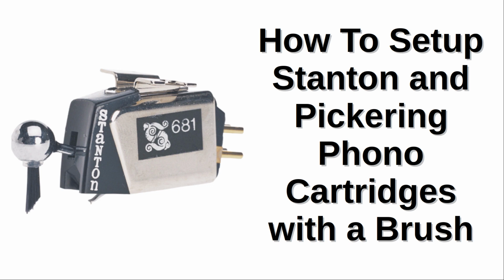My personal strategy, as far as playing around with my Stanton 680, which I'm enjoying listening to quite a bit, and I'm using it to play back 45s. I have a huge collection of 45s, and right now on my Fluence turntable, I am running an Audio-Technica VM540ML, which has that microline stylus on it, and it is not appropriate for playing old mono LPs or any type of 45, because the polystyrene 45s are very fragile, and the wrong kind of stylus, if it's not aligned exactly perfectly, we're talking about any sort of microline stylus or Vivid line or hyperelliptical, they're very, very hard on styrene 45s.